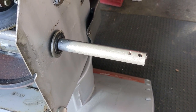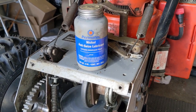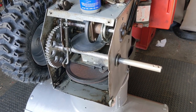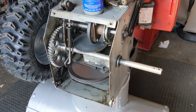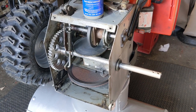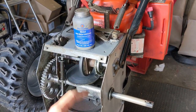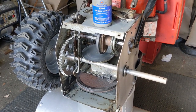You don't have to use Permatex nickel anti-seize specifically — any type of anti-seize will work great. However, a big shout out goes to Permatex for sending these products my way. I use nickel anti-seize in pretty much every one of my videos — on bearings, axles, even bolts under here for your access panel. I work on a lot of my customers' equipment every year, and I find it makes my life a lot easier the following year. If these bolts have a little bit of nickel anti-seize on them, they come right out. You see right there — the wheel just slides right off. As long as you do that every year, maybe even a couple times a year, you can slather it on there. This is 100% preventative maintenance, and it just makes things so much easier.